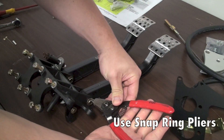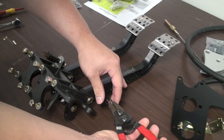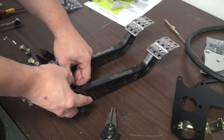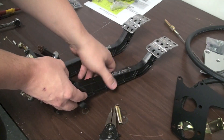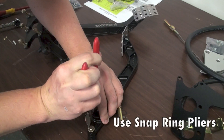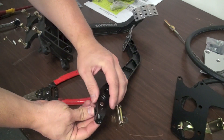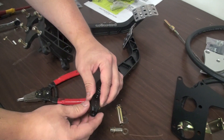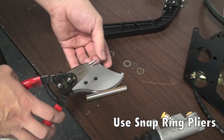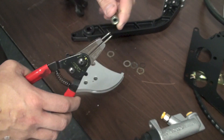We're going to start assembling the quadrant assembly to the clutch pedal. First thing we'll do is remove the pivot pin, and then remove the factory Wilwood master cylinder mount from the end of the pedal. With all that removed, go ahead and install the new clutch pivot spacer, along with reusing the hardware from the old pivot spacer, such as the washers and the snap rings.